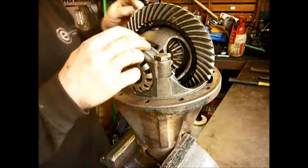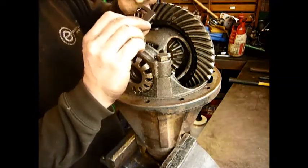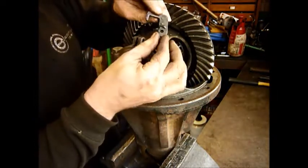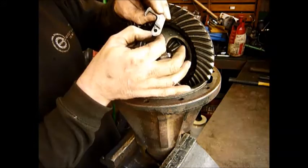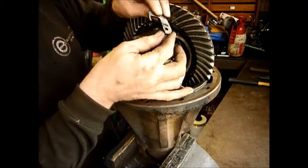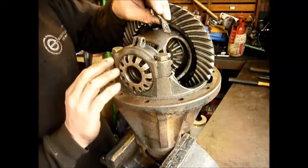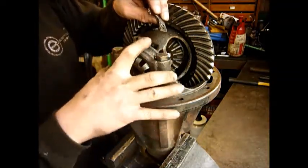Okay, I've taken the ears off and the pins out. The ears look okay on this one. There's a lot of rubbing going on here, but on this one here, something has definitely been getting hold of it. There's a big ridge of metal that's been building up here from chafing. It's ground away in here, and it's actually distorted the shape of this plate that holds the adjuster into this side quite significantly.